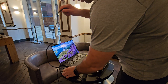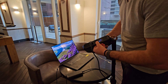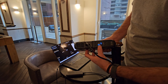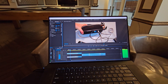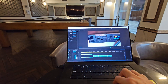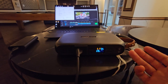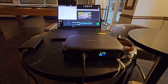You can bump it up to 300 watts. Let's see if this unit powers this computer — plugging in now, the light came on. Running Premiere Pro at 50 to 70 plus watts, it runs smoothly without glitches. Looking at Task Manager, it's consuming a lot of resources and drawing 72 watts. After 300 watts you can connect more devices — maybe two laptops, a printer, or a router — for traveling.